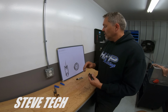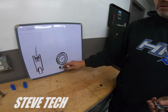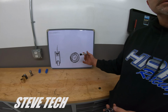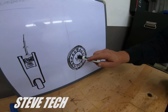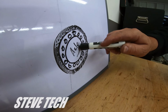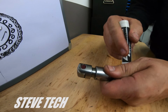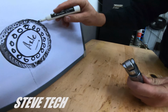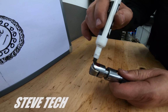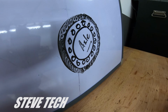materials of what we're doing. So if you look right here, I kind of drew this up. This is your normal bearing. So if you're ever hearing about bearingless or a bushed lifter, what they're talking about is this is normally your axle right here, right through the center. I'll show you the lifter. So that's your axle right there. That's your wheel. This is your wheel. And in between there is a little Torrington bearing, just these little needle bearings.